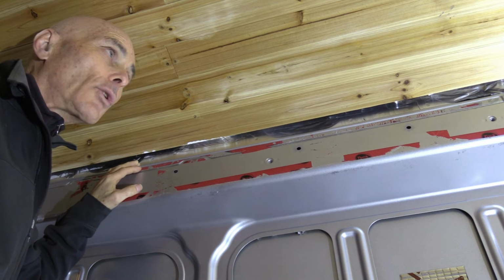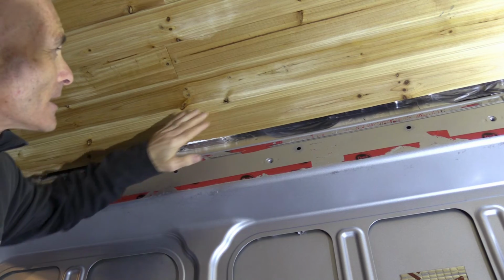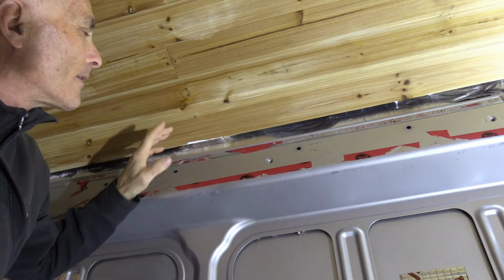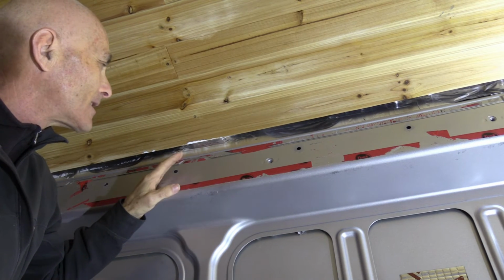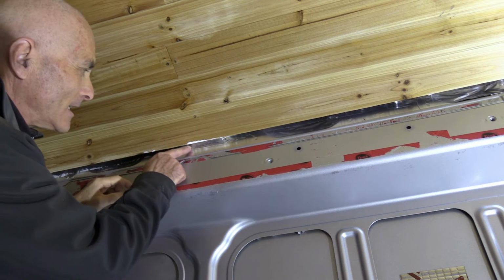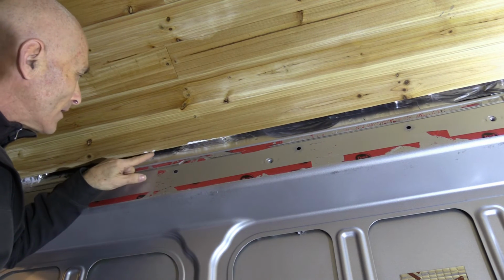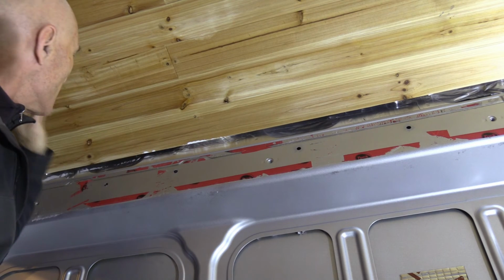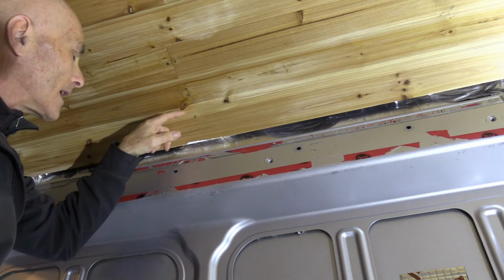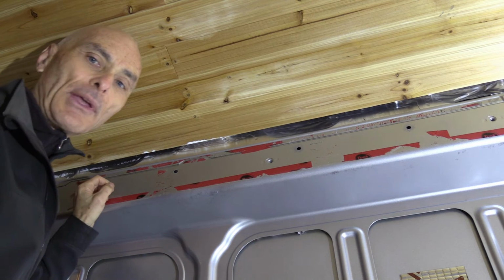And slowly, as the varnish was starting to dry, these dry spots, I think there's one you should be able to see here, started to appear, dry and whitish, and in some places the varnish actually dried like it was white paint. You can see it here. It really looks like white paint. There's a couple of spots here. In some other places between the boards, it looks like white paint. And I'm not sure how that happened.